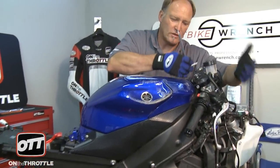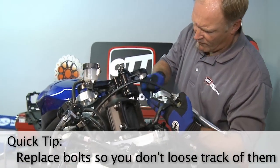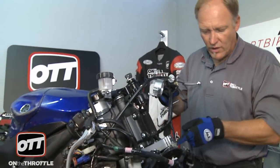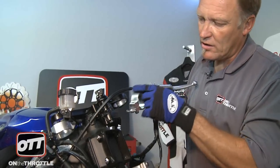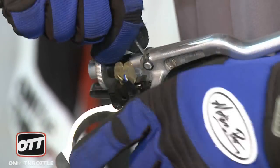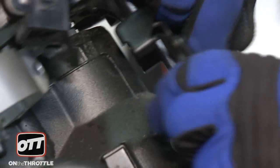When you're undoing the handlebars, they're eventually going to come loose, so you need to make sure that as you loosen them, you hold each one and then lay it into a position out of the way. This particular one will not come out of our way because we are connected to the horn. So in order to clear that we need to go ahead and remove the horn. We have an electrical connector on this side which we can unplug, but our clutch cable runs through a piece of the componentry that's going to go away, so we also need to disconnect the clutch cable itself. Now our handlebar is out of the way, all our electrical is undone. Feed the clutch cable completely out of the way so it's disconnected from the triple clamp.